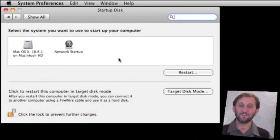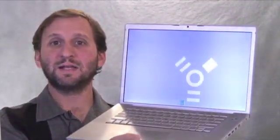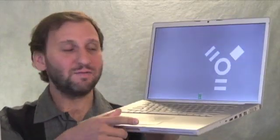It will do that very quickly — it only takes a few seconds to go into this mode because it's not really booting the OS at all. It's just going to a special mode to allow you to hook up to that hard drive using a Firewire cable. Once you do that you end up with a screen that has a big Firewire symbol on it. In this case, since I'm using a MacBook that's not plugged in, it also gives a nice battery indicator. The Firewire icon will bounce around on the screen and you are ready to connect it to your Mac.